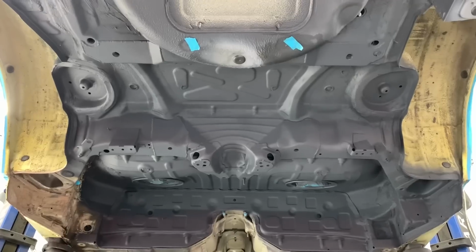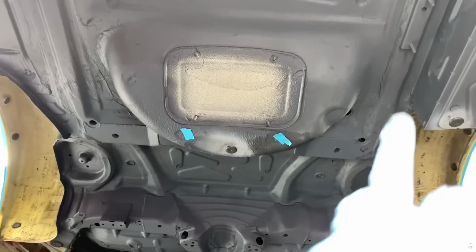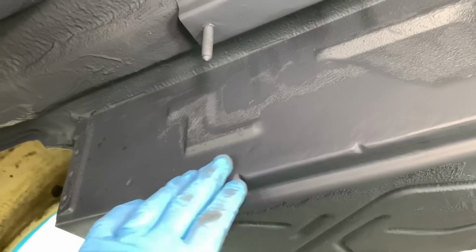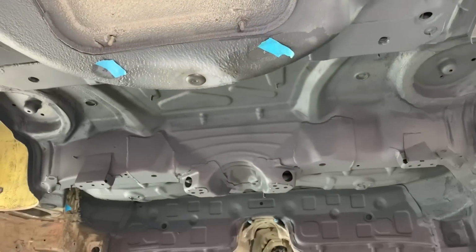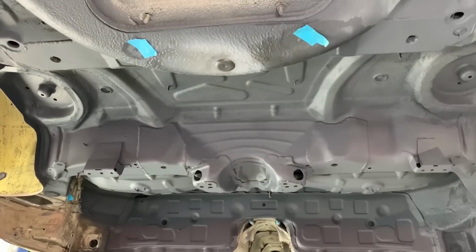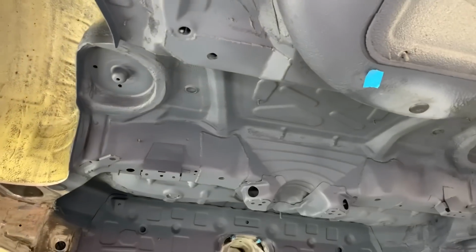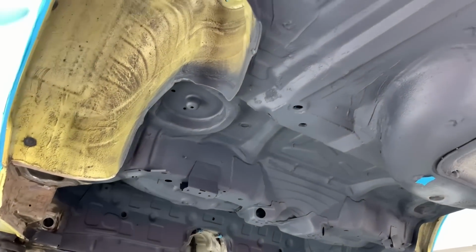Technician Dave's been doing a great job removing the corrosion around the rear of the vehicle, battery box area especially, where we typically had the battery box bracket corroded in the two upper ones. That's all gone now and been treated with rust converter. Been put into a stable state of graphene primer just to make sure it doesn't haze or cause any problems whilst it's on the vehicle lift for the next week or two, still having extensive other work done.